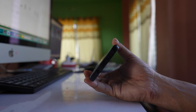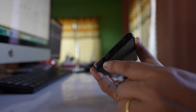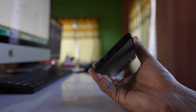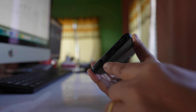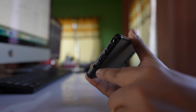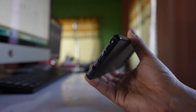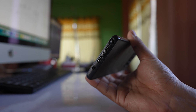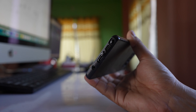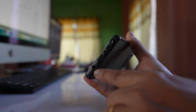At the bottom you will see the 3.5mm hole to insert the earphone jack. Use a sharp needle or a sharp toothpick and gently move it inside this hole. If there is dirt accumulated inside, that could be causing the earphone to be stuck in earphone mode. Gently move the needle or toothpick inside and remove any accumulated dirt.